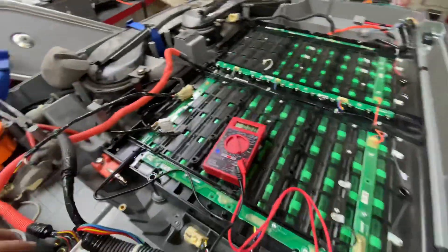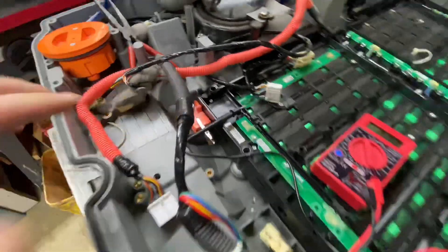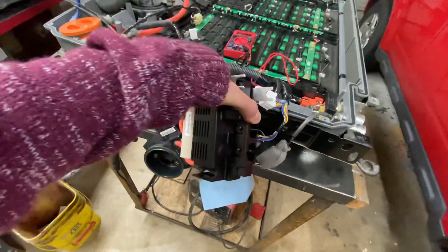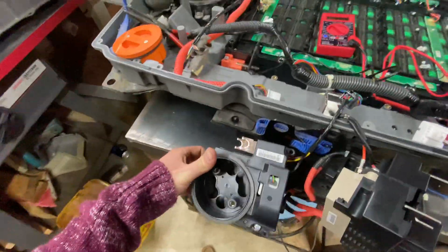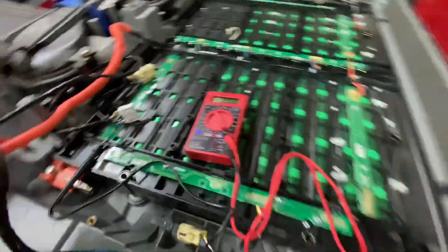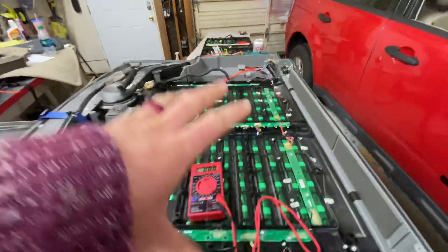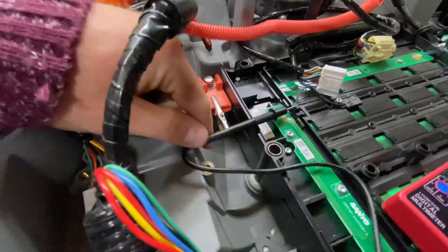So that's why you have to dive deep into the hybrid battery to do this. Don't try to hook up to the outer leads — you are going to have to tear out all of this stuff to access it. It's a pain, but you have to take that out just to access it. Once you get in there, you don't have to take the batteries fully apart. There are two batteries. You just have to access them and get the alligator clip in there.